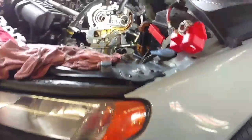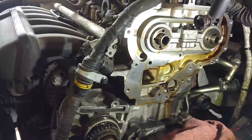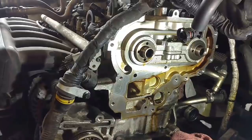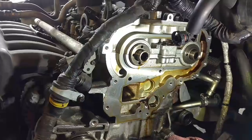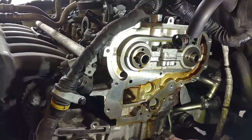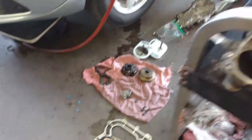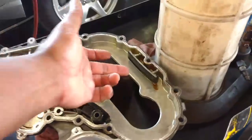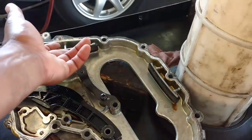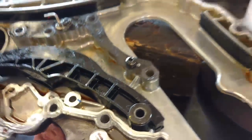Here at Nordic, they have a V70 3.2 torn apart for oil leaks. Water pump, timing chain, all that stuff is off because of the gasket in there leaks. And all that stuff laid out, that's the gasket. Part of the engine, timing chain guides. Those things still look like they're in good shape. Don't need to be replaced, not cracked.